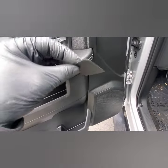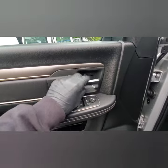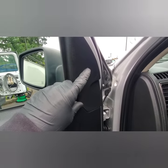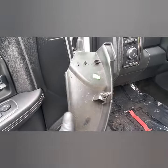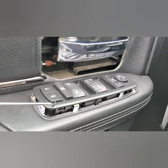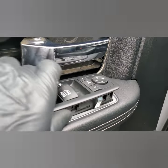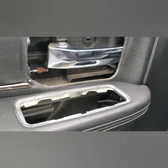Use your hook tool for this plate here, which goes right there. Pop it out of there. You've got your Phillips screwdriver and your Phillips screw, and you're gonna pop this piece off with your hook tool — get it back there and pull it. That's in there with clips, just pops right off. Alternatively, instead of waiting to pull the wiring out the back, you can use your hook tool, pry it up — it's just got these metal clips that hold it in — and disconnect your wiring from here. It's a little bit easier before you pull the door panel.